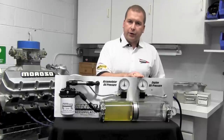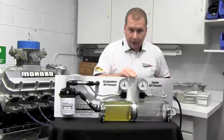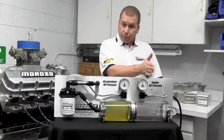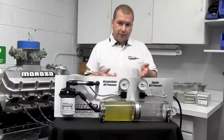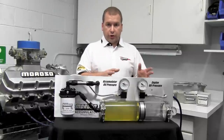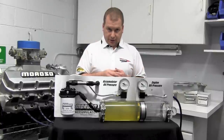For a long period of time, we're losing oil pressure and it's down a bit. You can see how the accumulator keeps picking things up and giving the engine oil until it finally matches the pressure on the back side of the accumulator. Oil pressure is back up, the pump has picked up prime, and we're going to refill the accumulator. This is what goes on constantly — and this is really the reason why you bought it: to maintain the volume going to the engine.